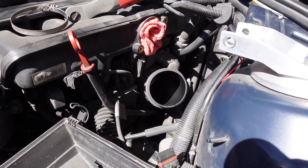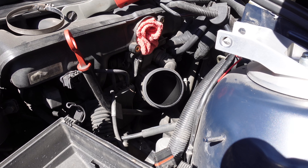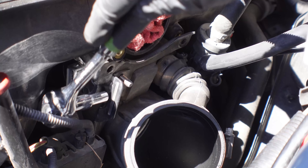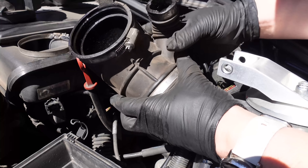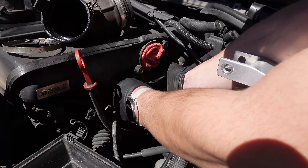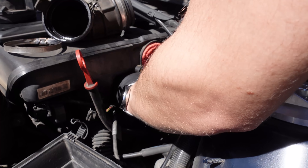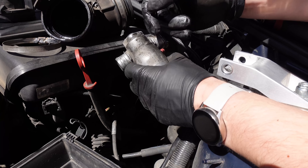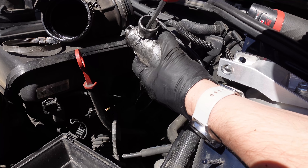I suppose it'd help if the camera was actually pointing at what I was talking about. This is the lower boot. This baffle here — you usually see failures there. The Jubilee clips are totally facing the wrong direction. I found a deep six. I used some penetrating oil — it worked a treat. What's missing to get this guy out of here? It just pulls out. So that's the idle air control valve. I believe it's supposed to be able to freely move, and it does.